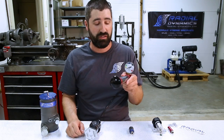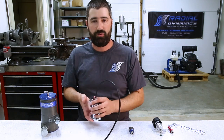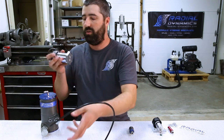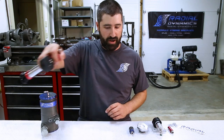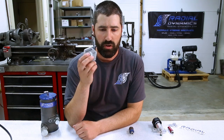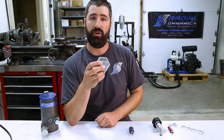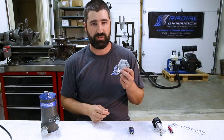But the actual holding pressure is really only a few psi — it doesn't hold nearly as much as I expected. The reason is because any of these valves — and a radiator cap is a valve — the pressure across it is going to be dependent on the rate of air, oil, or coolant that's actually flowing past the cap. As that flow rate increases, there's a pressure curve that increases proportionally. So this cap is limiting a maximum 8 to 10 psi while it's venting, but its actual holding pressure is going to be significantly less.